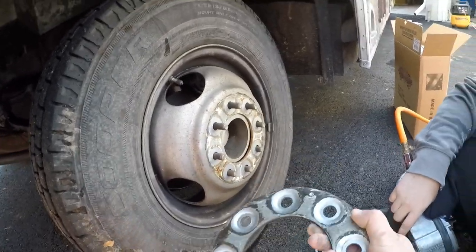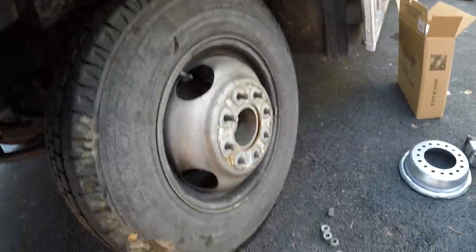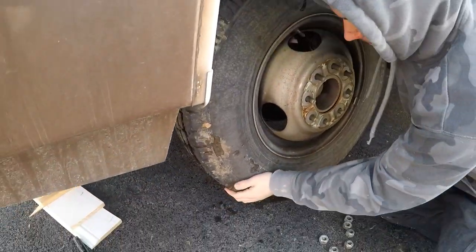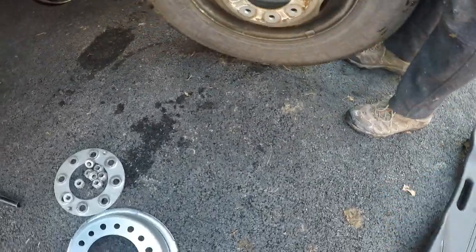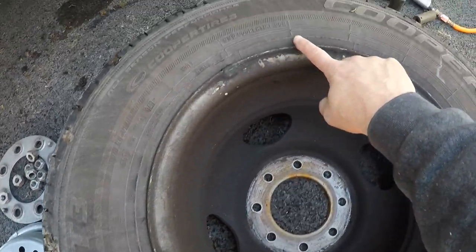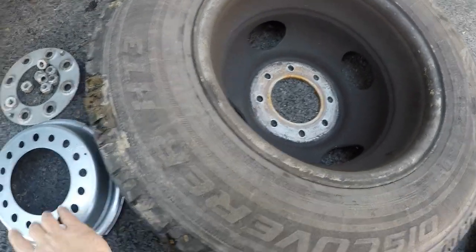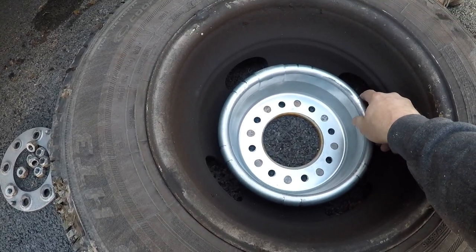There's the ring — you get out of the way so you can pull the tire off. We've got our Centromatic wheel balancer here. Your hands are going to get dirty, but so what. Now you want to lay it face-down on the ground, because per the manufacturer you need to check the centering bead to make sure it's even — and it looks reasonably even. You also want to line the bolt holes up with the bolts.